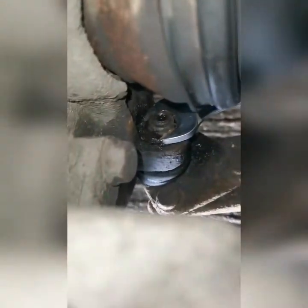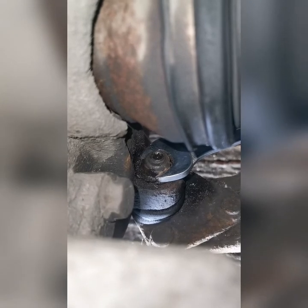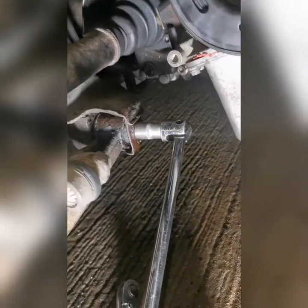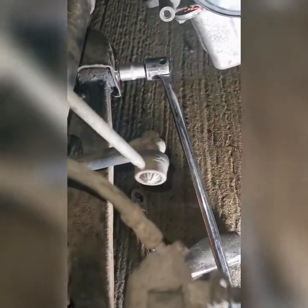I've got the hammer out and I've got a 17mm on it — I've hammered it onto the side so this probably isn't best practice, but it's just the way to get it moving, which it has done. I've got a lot of WD-40 on it. I started tapping it on with a hammer and then tapping the edge, and eventually it started wiggling. Now I'm using my half-inch breaker bar and an 18mm socket and just slowly turning this — it's slowly coming undone.